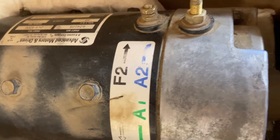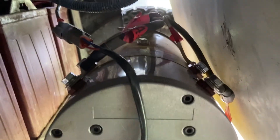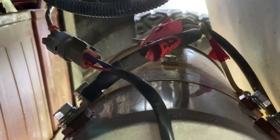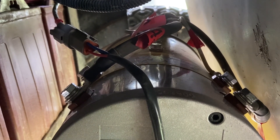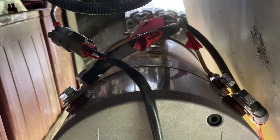Once you've got your motor out, you just have to connect the cables back up. On the back of the motor you can see the connector — I basically had to cut that off because this has a triangle-shaped Deutsch connector and the other one was a three-wire side-by-side. Just tape off the cables, mark them when you take them off the other one, then you put them right back on and it should be good to go.